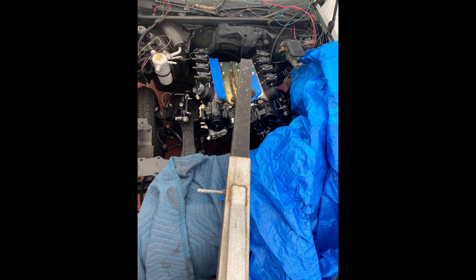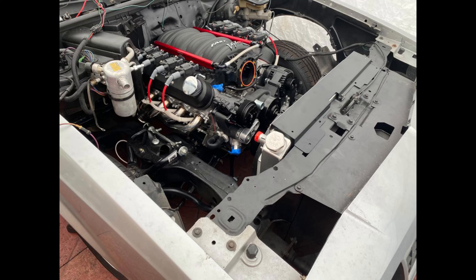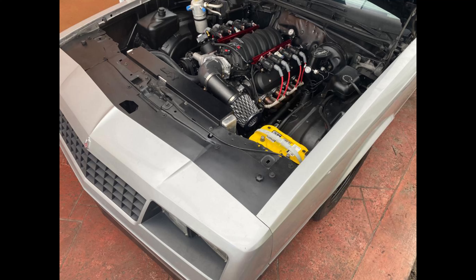This is my second LS build done in my backyard, so I am no expert — I'm learning as I go. I made a rookie mistake when building this LS3: on first startup I was having low oil pressure and literally freaking out. I contacted friends with more LS experience and we went back and forth — could it be a cam bearing, pinch O-ring from the oil pump, O-rings from the valley cover, cam retainer plate gasket? When my friend mentioned valley cover O-rings, I remembered I had installed a new gasket but did not replace the O-rings. I removed the valley cover, installed new O-rings, and the problem was fixed.